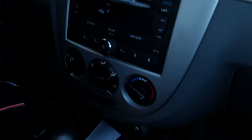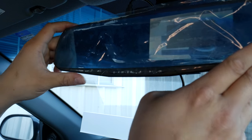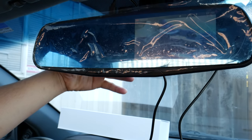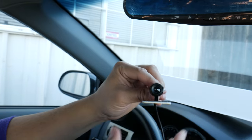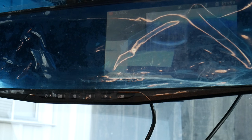I just turned on the accessory mode. There's a red LED light in the cigarette adapter to confirm there's power. Press and hold the unit until it boots up — it took a little while but not bad. The front camera is working. The reverse camera is also working. Make sure the bracket is on top — if it's on the bottom the image will be upside down. With the bracket facing up the rearview camera image is right side up.